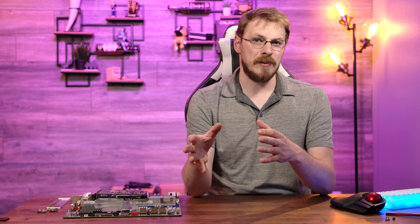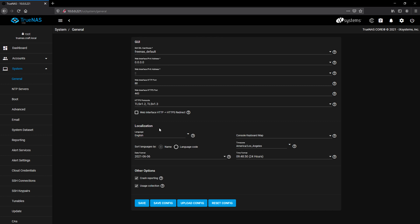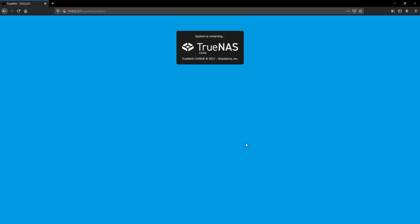As far as getting everything back up and running, I could have just thrown my old boot drives into the new system and it probably would have worked just fine. However, I wanted to do a fresh install of TrueNAS just to make sure that no lingering issues from either my hard drive swaps or any of the hardware swaps were going to present themselves in the future. Before I started the hardware swap, I took a backup of my existing TrueNAS configuration. Once all the new hardware was nestled into its new home, I simply reinstalled TrueNAS and then uploaded the old configuration file. A quick reboot later and all of my ZFS pools, file shares, and accounts and permissions were all restored and back up and running.